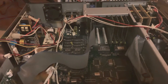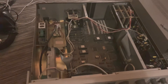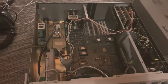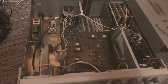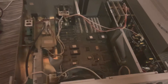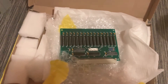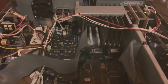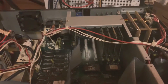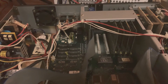Maybe I wasted some money, but it turns out I've got another one here that already has some cards in it. These machines are cheaper than trying to buy the cards spare. This was the eight megabyte card which I'm going to sell, because it's not recognized — it just shows up as another two megabyte card unless you modify the motherboard. I managed to salvage four two-megabyte cards, which gives me eight megabytes total. I can live with that.